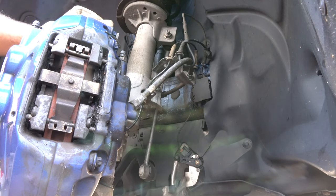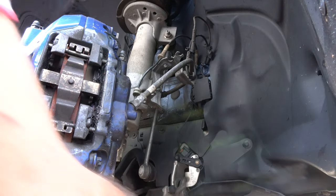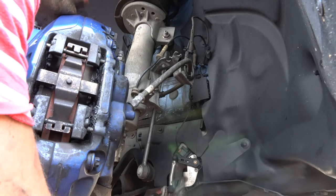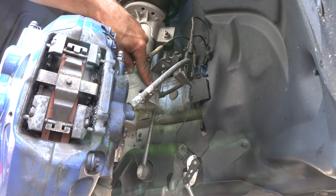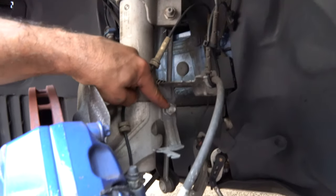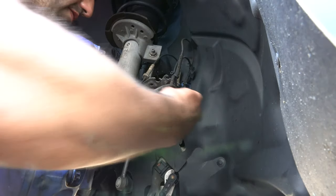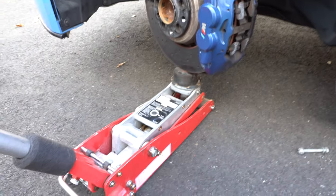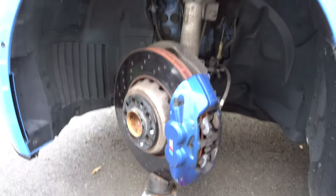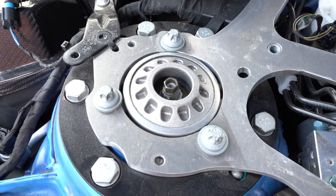This is the driver's side wheel and we're going to have to disconnect a couple of items here. We're going to disconnect the brake wear sensor and ABS line from here — they simply pull away. There's also that leveling sensor: it's best if you grab needle nose pliers and it's a 10 millimeter bolt. Next is loosening up the strut — this is a 16 millimeter bolt that we're going to remove, grabbing it on the other side to prevent it from spinning. No need to save it because we're replacing it with a new one from the kit. We'll put a jack under the rotor with a rubber pad, jack it up a little to release some tension and compress the spring, which allows us to undo this top nut — it's an 18.